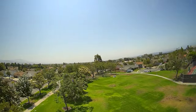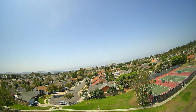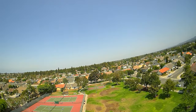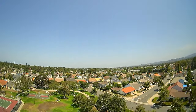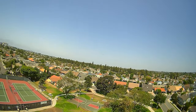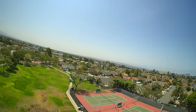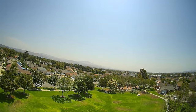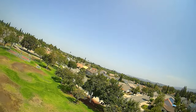The white balance and color reproduction is a little bit off — certain off-white colors tend to show up as grayish with a little bit too much yellow in my opinion. However, the sky looks pretty accurate and blue, and it's close to the way the DJI camera looks. Grass and trees are also fine. It's just a slight yellow tint in certain lighter colors, and I think that's a white balance adjustment that may be fixable in firmware. It's not a big deal and doesn't bother me much when flying, though it is noticeable in DVR footage.